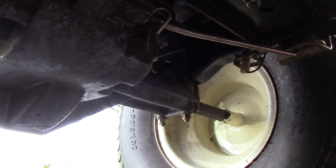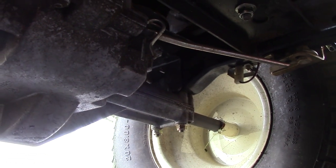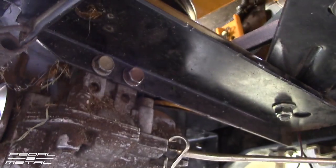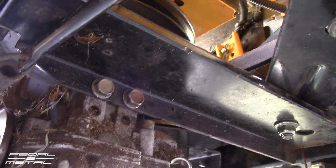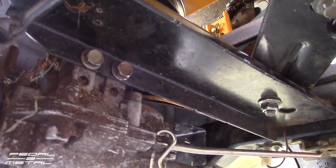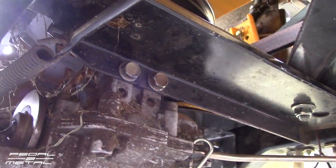The other way to get to these varispeed pulleys — you can kind of see it on the other side — it's just two bolts that hang down there that hold the whole transmission on. You yank those two bolts and then these two right here — there's one here and one here. It's only six bolts you need to pull and that whole transmission falls right off. You just pull this pin here and I was able to pull the whole thing out with the wheels.